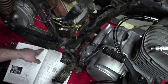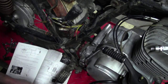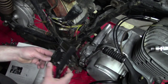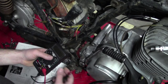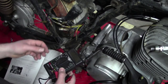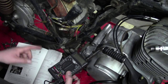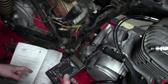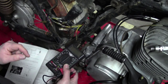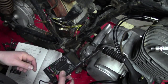I've got everything set up here. I've got my service manual open to the page that tells me how to test the windings on the magneto, and also shows the ohm readings. You're going to need an ohmmeter — these can be gotten anywhere for as little as five bucks. They're kind of a get-what-you-pay-for item; more expensive ones are more durable and accurate. But for these kinds of tests, even a five-dollar one is suitable. I'm going to test each wire, write down the readings, compare them to the book, and determine if that's the problem.